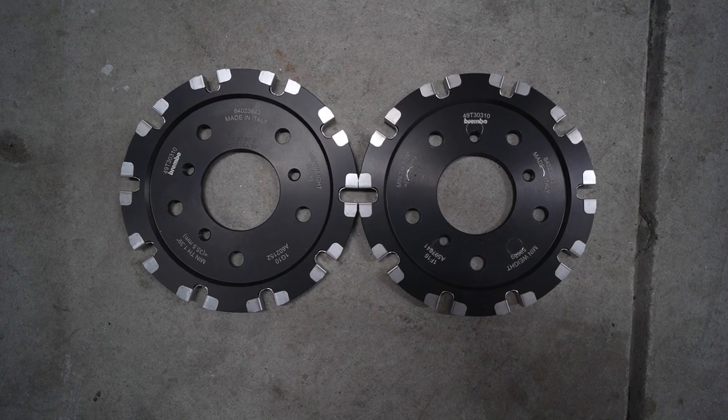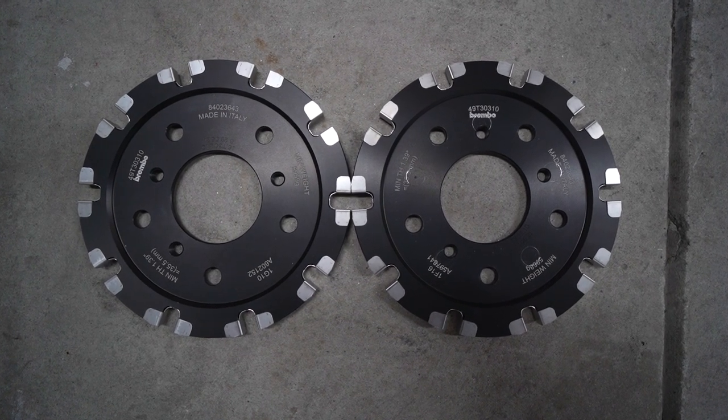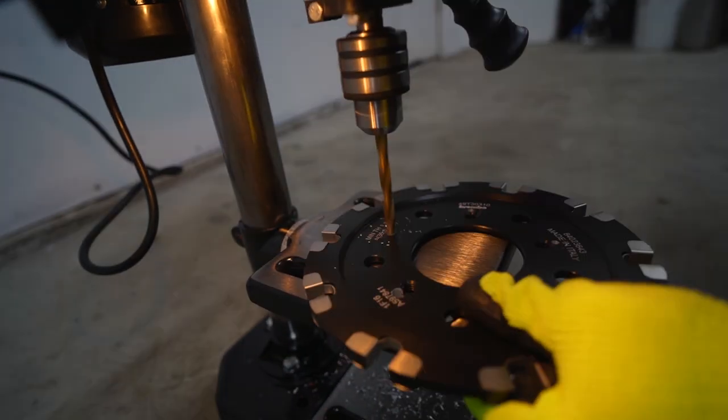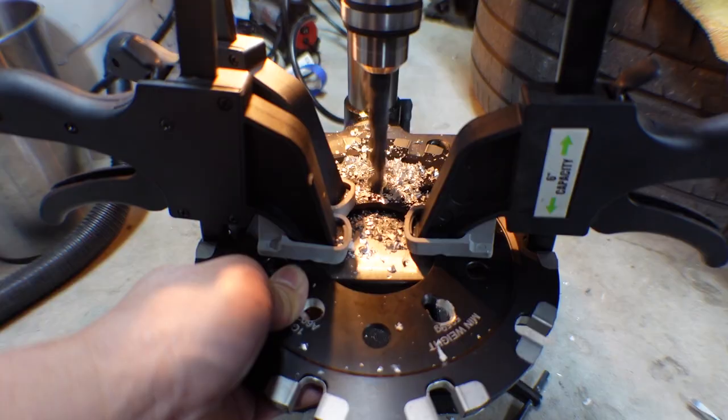I scribed the Corvette hat with a 5x114 bolt pattern and used a center punch to make a small dimple in the middle. After that, I drilled a pilot hole for all five holes, followed through a second time with a larger drill bit and came to my final diameter matching the GTR's wheel studs.